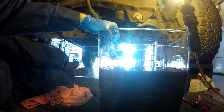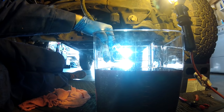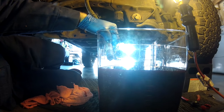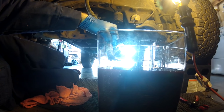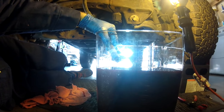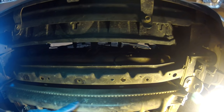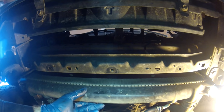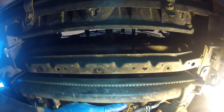If you're wondering where all this fluid is coming from once we drain the pan, the torque converter on the transmission holds a lot of fluid. So you're mainly getting the leftover quarts of fluid in the torque converter. By running the engine and letting it drain out, you're pushing the new fluid from the pan through the system, flushing out the torque converter and going out via the return line from the radiator cooler. This is like a marine-type cooler where the cooling fins are immersed in the coolant - that's how they're being cooled. The engine coolant is drawing away the heat from the hot fins when the coolant is running through there.